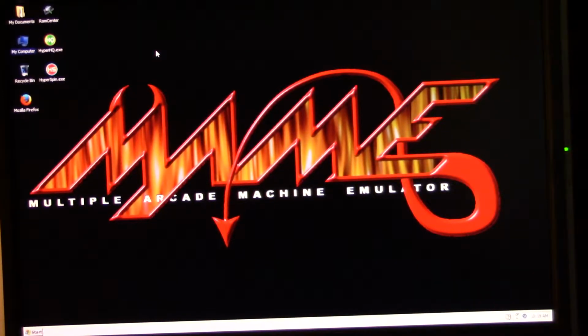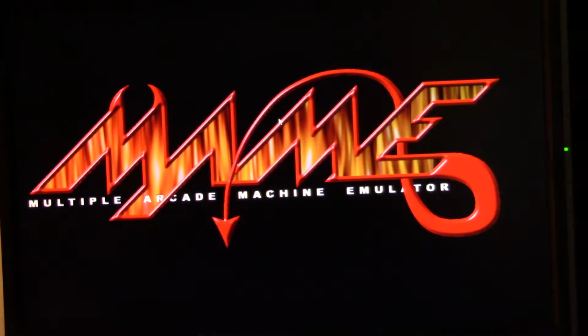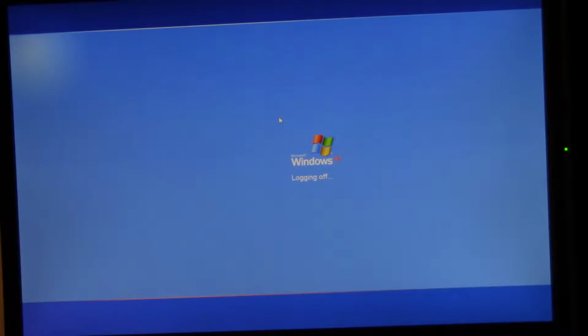But after we get that all installed, because this is a Mame arcade machine, we don't need stuff like a serial port or a parallel port running. We just need basic hardware. So I'm going to shut this computer off, and when we turn it back on, I'm going to enter the BIOS, the basic input/output system. We're going to make some changes there and turn some things on, turn some things off.